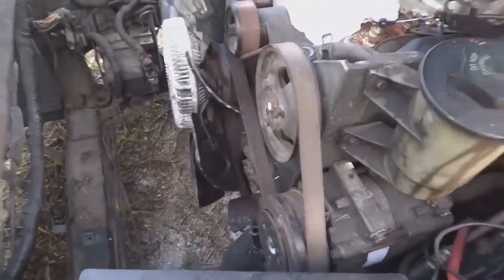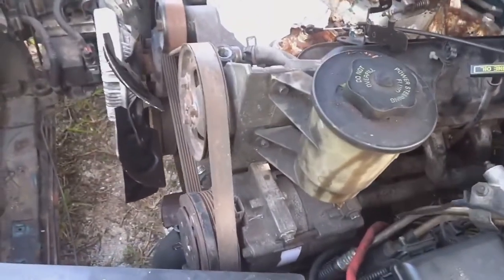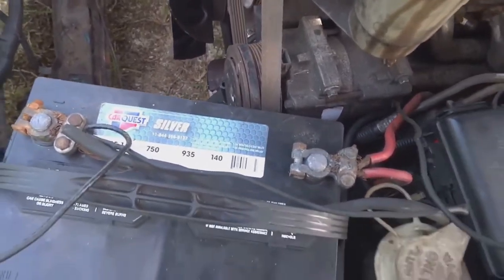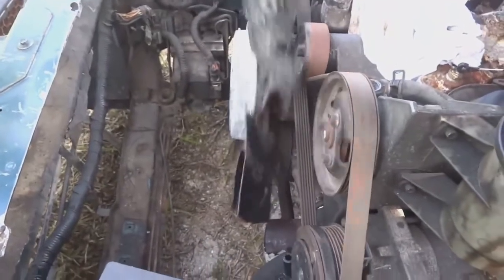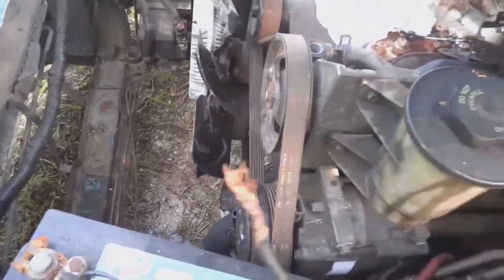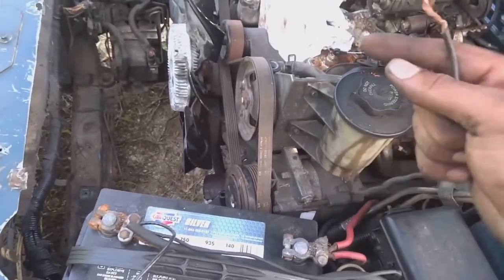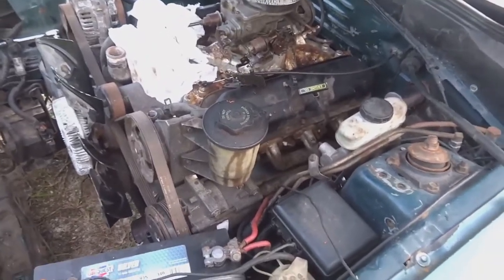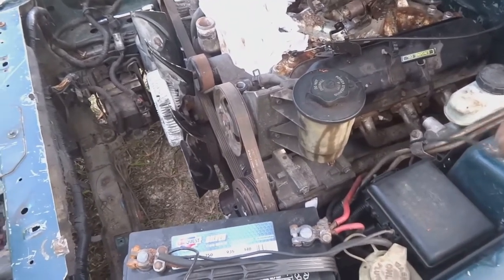All right guys, so I figured out why it wouldn't start. It seems like I have the right starter, I'm hoping so. There's this wire that comes from the other side. You know, there's a positive, and then you put the negative on the motor, and then there's this wire that was connected to a ground. It seems like you have to connect this one to a hot when you swap it from the automatic to this one. So it's rolling over fine now. I'll just have to run this to a switch, and then from the back side of that switch, I'll have to run it to the positive, turn my key on, and then flip that switch so I can start the car. So I'm getting it to roll over. I'm gonna see if I can get it to roll over with the ratchet now that it's moving. If not, I'll just have someone roll it until I feel that compression come from that number one, and then I will stab the distributor.